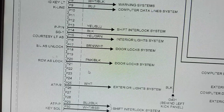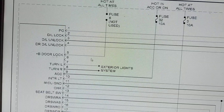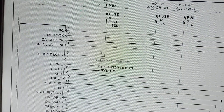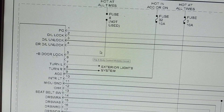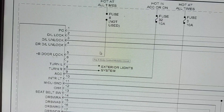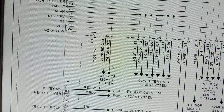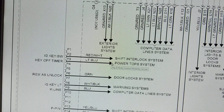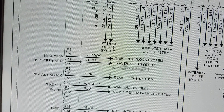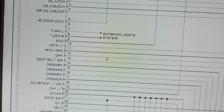When we look through the pages and ask ourselves: can it be the battery? Well, if the battery were bad then the car wouldn't be cranking in the first place. The alternator is working, the starter worked - we got to the point where the car is running, even though we have problems with the exterior lights and warning lights. If you want to know how to test the battery, go to the channel Joe Electronics Schematics.